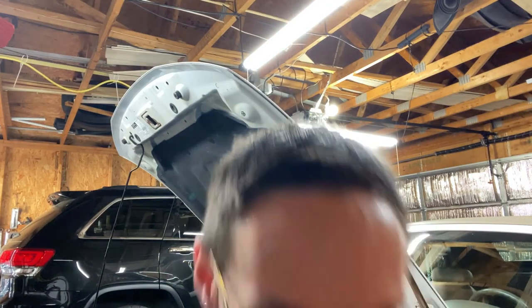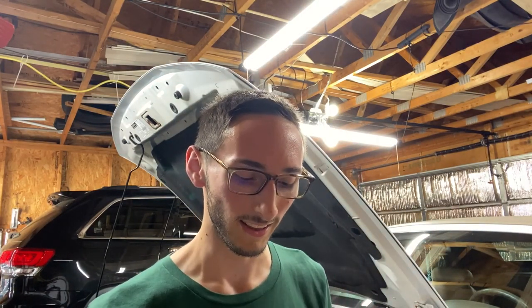but I have heard of people saying, yeah, my check engine light came on for the car running too lean and the car kept stalling. That's a real thing. People's cars will actually stall out and it just won't feel good. It's going to feel like the car's misfiring like crazy, and it's just not going to be a smooth ride. You're not going to be able to drive it on the street comfortably. And that's what happens when you go really crazy with cams.